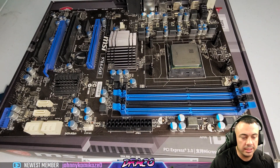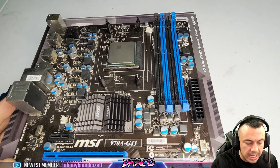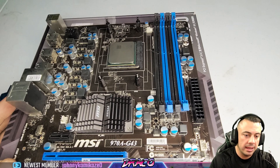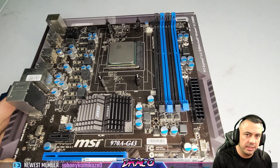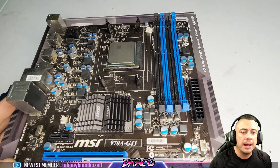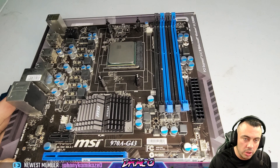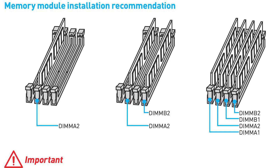That's proper memory removal — whether you're upgrading or installing fresh RAM on a new board, this video covers both. What you want to do is look in your motherboard manual to see which slots are the primary slots. It'll tell you how to properly run dual channel. As you can see, this is a dual channel board for DDR3, DDR4, DDR5, whatever you're using, and you want to make sure you're running it in the proper dual channel slots and mode. Refer to your manual and look at the writing on the motherboard itself.